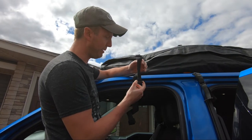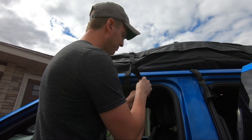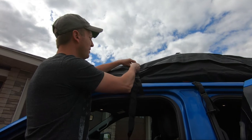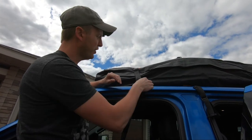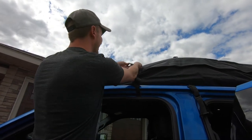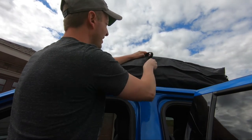Now you want to take your four supplied door straps. Gently pull down on your weather stripping, slide the clip up underneath the sill of the door, and push the weather stripping back into place. Take your buckle, slide it through the loop, and reclip your buckle. Go ahead and do that for the other three straps as well. When you're all finished, take your strap — your loose end — and snug everything down. Then take the velcro piece and attach it at the top so it's not flapping in the wind. Finally, take the other straps, clip them up, and just snug them up.